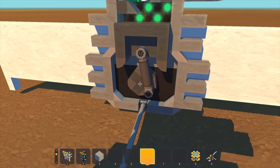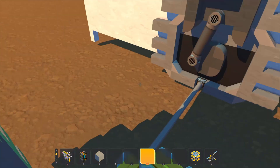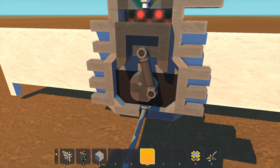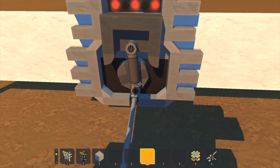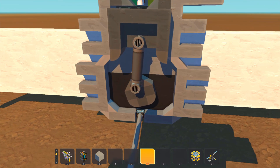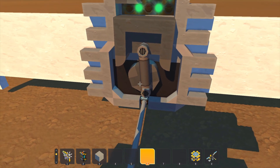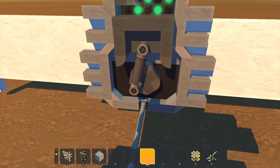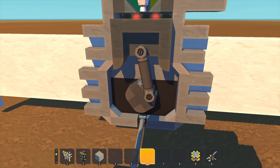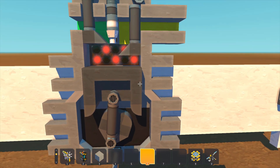Looking inside the engine, the first component is the crankshaft. The crankshaft is where the power comes in and out of the engine — it's also what runs the pulleys on the outside for timing. On small engines there will often be a counterbalance, which is what you see here, and sometimes an oil agitator. In the bottom of the engine you have a reservoir of oil, agitated by an agitator on smaller engines or pumped by an oil pump on larger engines to lubricate specific points throughout.